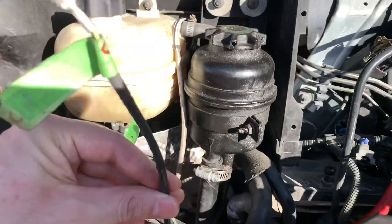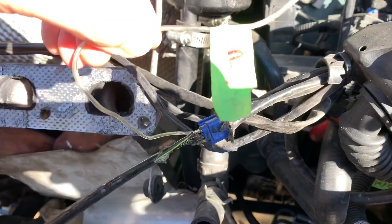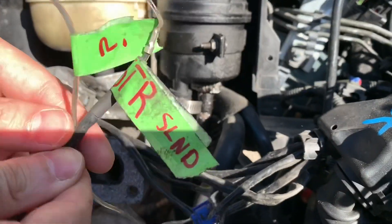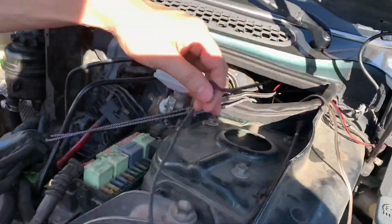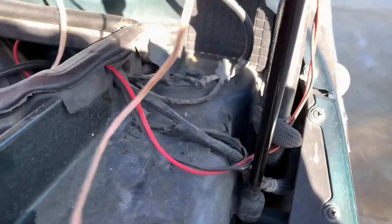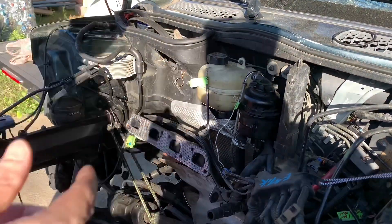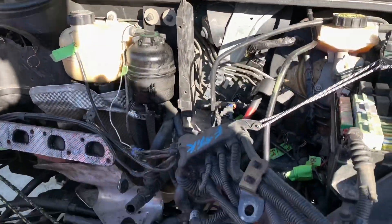Take a look at this right here — look at when I removed it. Can you see that in there? I put a little question mark on some speaker wire that this guy did. And after removing the engine, I discovered that it's spliced into the starter solenoid. And speaking of splicing, let me show you what this guy did as well. I mean, look at this — this is household cord. More speaker wire. It's just a freaking mess. So much issues that I discovered — the wiring, all that goop, all that silicone, all the splicing, that driver's side shaft was leaking.